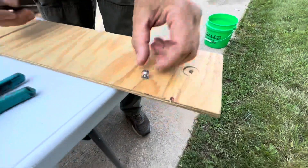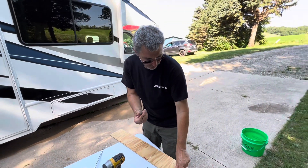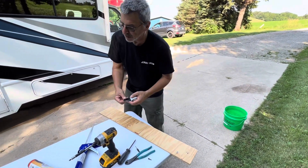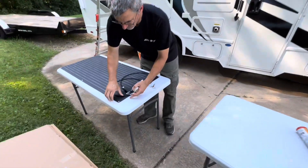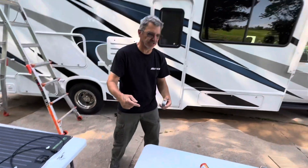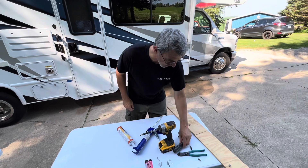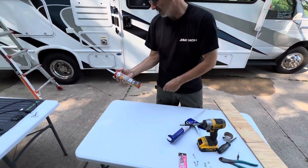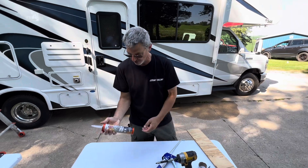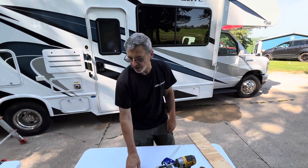I've got a woodworking bit for a number 10 screw pilot. I drilled a pilot hole to test this out and it's very secure, so that's what I'm going to use. I'll drill a pilot hole, then run a screw in. Before we run the screw down, I've got this RV butyl tape and we'll put a piece of this tape between the roof and the grommet to seal underneath and not have a leak path. After we screw it down, I'll use a screw gun and maybe finish with a screwdriver. Then I'm going to use Dicor lap sealant — pretty expensive for just a few drops, but I don't want the roof to leak.